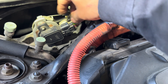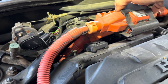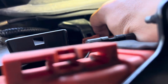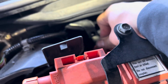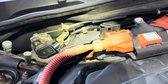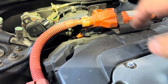To get access to the whole assembly for the connector, you're going to press on this tab and pull. For the hybrid cable, press on this tab and pull to the side. Same thing for this one — press on this tab, pull to the side. Take out this bracket; there's a 10mm right here holding onto it, and then reach under to get the 10mm bolt because the bolt is mounted upside down.